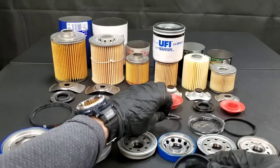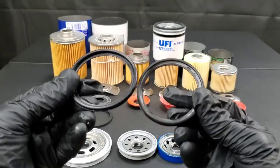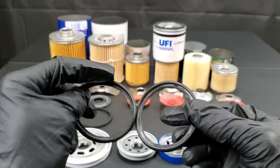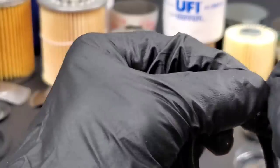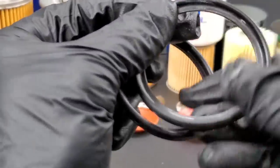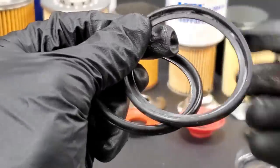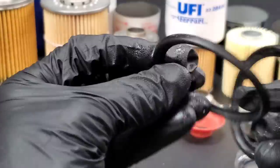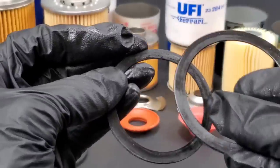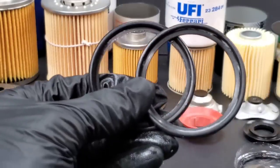Let's check out these other nitrile gaskets, as they would all appear to be made of a nitrile rubber. On the left we have the Nissan nitrile gasket, and on the right we have the Honda nitrile gasket. There appears to be a gunk that's built up on the Honda nitrile gasket. I've seen this gunk build up on many oil filters, so this is one of the best telltale signs of quality concerns or issues that you may have with a product.